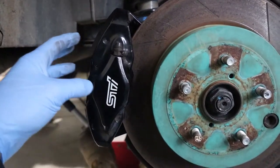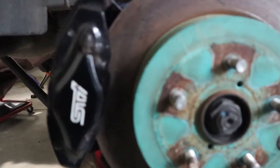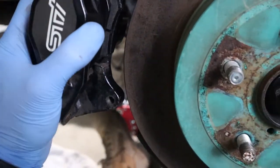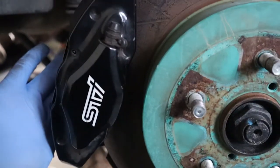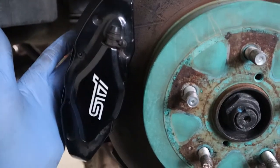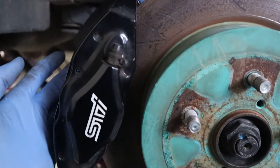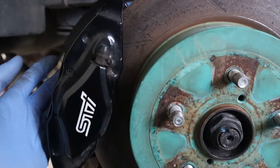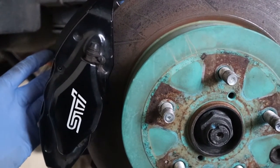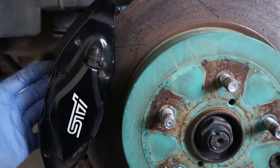Obviously with this side I wanted to try putting the brake pads in and then putting the rotor on — you can do that, I just found it a little tricky. But honestly, I think the best way is to put your rotor in position, put your brake pads in, then put your pins and retaining clip on, and it's as easy as that. Then you can bolt it up beforehand. What this also means is you can leave the caliper bolted on, just pull the pads out, and put the pads straight back in — an easy process if you don't want to clean inside around your piston seals.